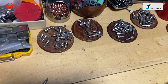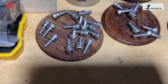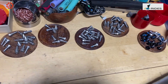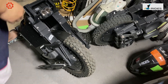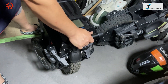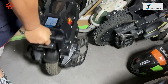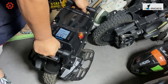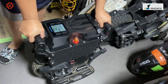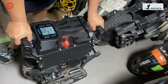Just to recap how many screws there are on the Patton to do this — those are the screws you need to remove: one, two, three, four, five — that's the amount of screws you'll be looking to remove. After it's been tightened — the suspension bolt, the axle bolt, the clamp — this is what it feels like. Perfect. No more noise now, nice and solid. So if your Patton is rocking about, you know what to do — it's the bolts on the suspension clip. You've got to take it all apart and tighten it.